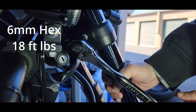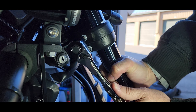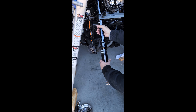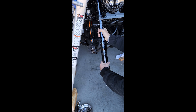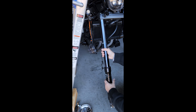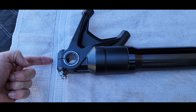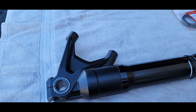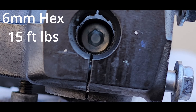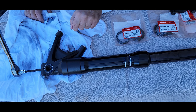Now it's time to take the bike off the stand and let the hoist do its thing. There we go — we have success. These are the last two bolts that we have to undo on the lower triple and that will release the fork leg. Make sure you secure the leg before undoing the last one because it could slip. The fork leg is free to come out — let's continue to pull the leg through.